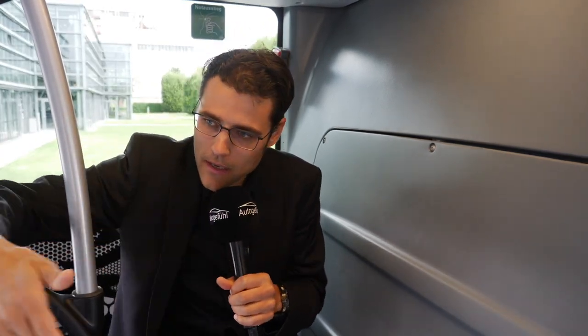talking about warmth, the thermal management of this vehicle is basically the key to the real range, because as I said earlier, usually the range would be cut in half if you think about heating, ventilation and cooling. And you think about, in winter times, the doors opening and closing again. While opening, all the warm air gets out, for example, or when it's really hot in summertime, and therefore they optimize the thermal management.